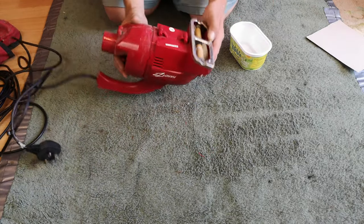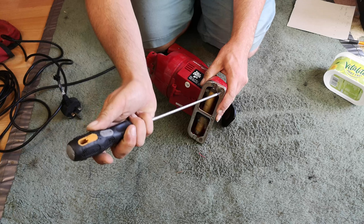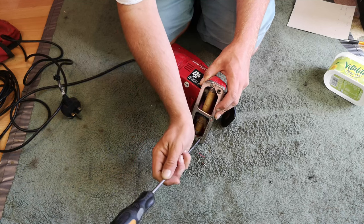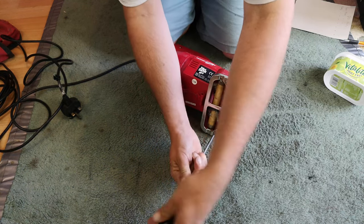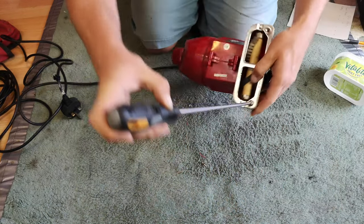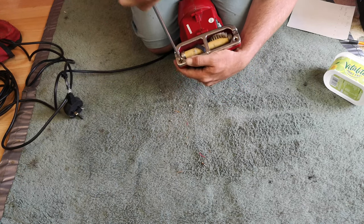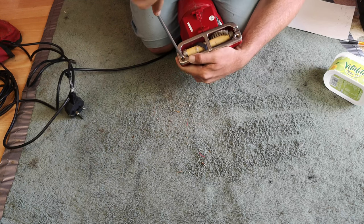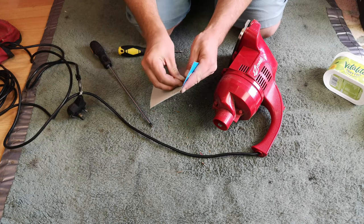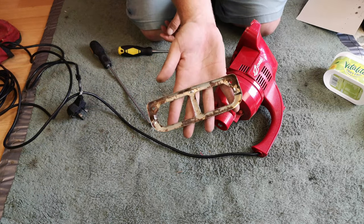All of a sudden we are down to not a great deal here, and we can start with our first two screws. It's a reasonably simple vacuum cleaner - we just need to remove the two screws holding on the base plate. What idiot's been here before? Oh, I hope it's not cross-threaded. Struggling here - I don't know whether we cross-threaded it in the before video or if a bit of grit got in there, but never mind - it's off now.